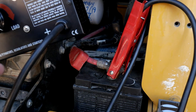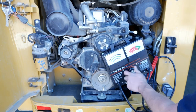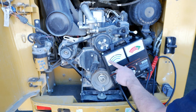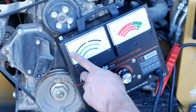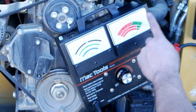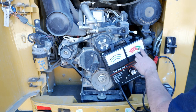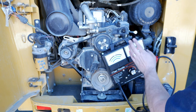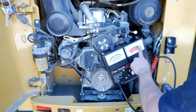Whenever you're hooking up your carbon pile, it's good to make sure you back off that carbon pile — turn this knob all the way counterclockwise — and that's going to make sure we're putting no load on. We can verify we don't have any load on because the gauge for current is reading zero. We can also read that our OCV voltage of this battery on this analog gauge is showing somewhere around 13, though these are never the most accurate gauges. An open circuit voltage of a battery would be about 12.7V, so within reason that gauge is looking not too bad.